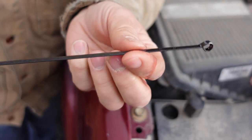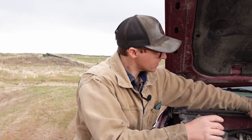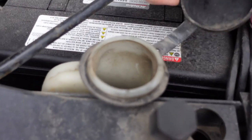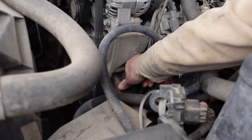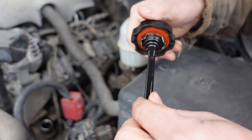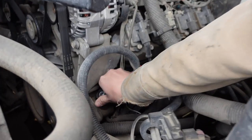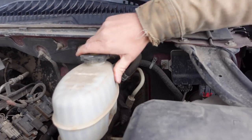There's a hot and a cold reading on the transmission dipstick — the car should be running and in park for that procedure. I forgot to mention windshield washer fluid — it's good to have. Next is power steering fluid. This car has a leak so I'm actually topping it off. Same type of thing here — you get hot and cold readings. There's an aftermarket dipstick on this one, but you'll just check the level on your dipstick.